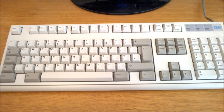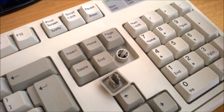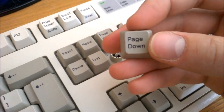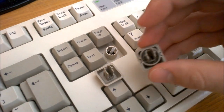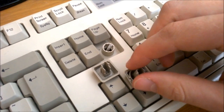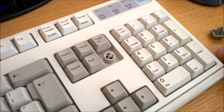And finally, they arrived at this — their last ditch attempt to make a Buckling Springs design. Some things IBM obviously tried to keep at any cost: it still has Buckling Springs, and the keycaps are still fairly thick PBT with nice dye sublimation legends. They're not quite as thick as ones from the Model M, and the M2 keycaps only come in a single-part variant, whereas old Model M's usually come with a clip-on design. But overall, these are still very good keycaps.